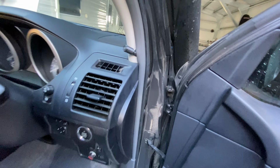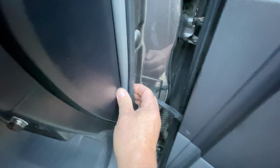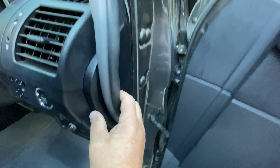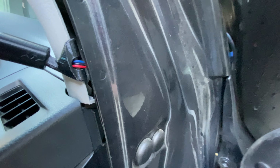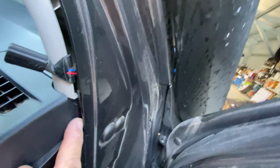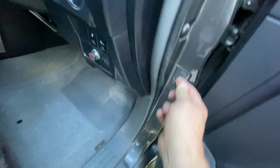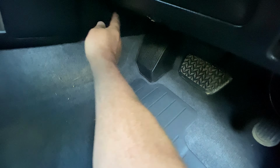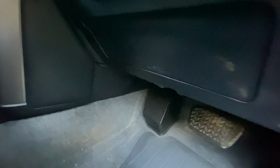And to install the LED switch, which just sits in there, it's just a case of pulling back the door trim, like this. And you can see that the switch just mounts, it just clips onto the A-pillar trim. And then the cable just goes down here, and then you just route the end through there, and it can go underneath, up around here, and then through you take this trim off like on the other side, it'll go through to the control module.